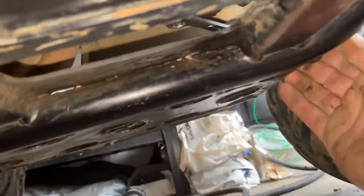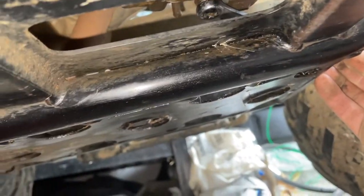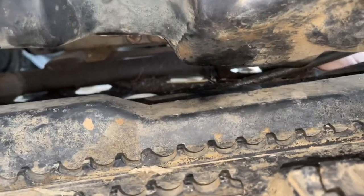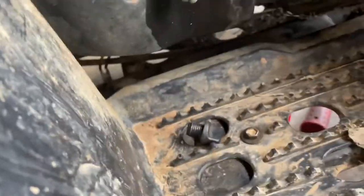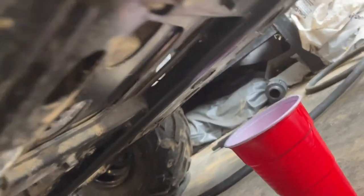It's kind of hard to see here, but see what I got my wrench on — that's the gear oil drain. I just want to crack it loose. Sometimes it's kind of tricky; it's on there pretty tight. Get a little hammer and whack that wrench, or if you've got a socket that can reach up there that'd probably be better, but I can't find my 12 millimeter socket. Once you've got that all loosey-goosey, take your fill cap out — it's a little plastic cap — and work the drain bolt loose with your hands and drain it right into this little cup here.